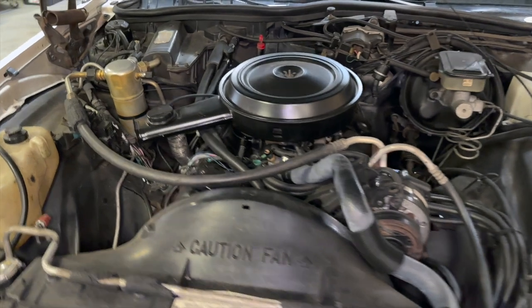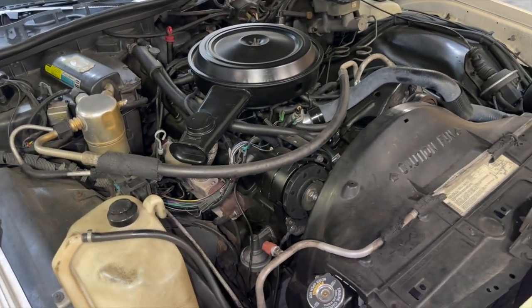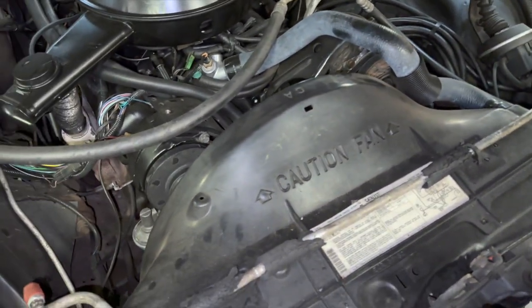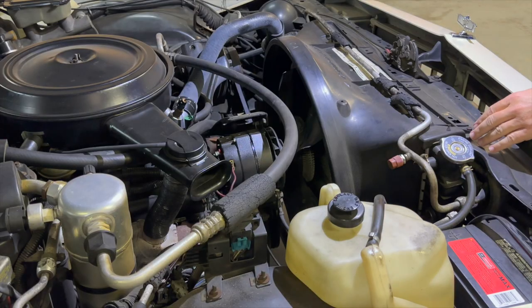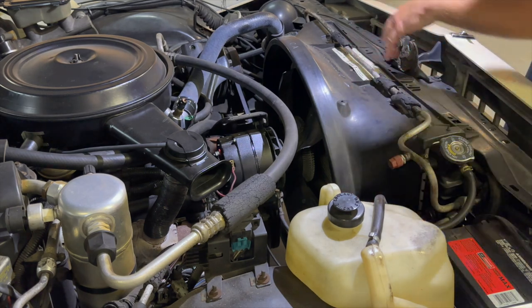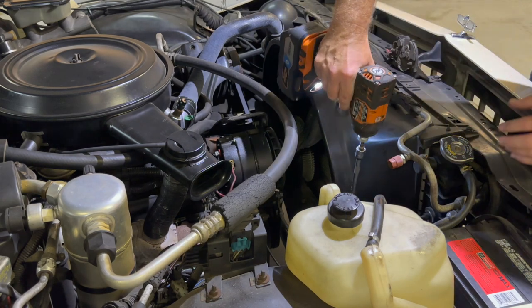As I've seen under the hood of this thing before — if you haven't, go check out some of the other videos, I will tag them below in the description. This thing is all stock under the hood. So we've got to take that fella out of the way and just get the clutch fan off. I didn't realize how bad a shape this shroud was in, but we've got a couple of different bolts — two straight down here, same on this side, and then just a couple across the tops. Let's get those zipped out real quick.